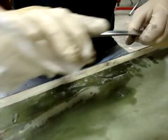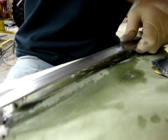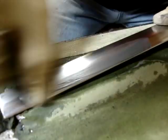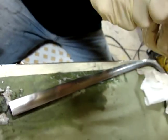So that's the 600 stage. You can always check it and see if you see any deep scratches — you'll want to back up and do a little bit more. I can see just a little bit of the 400 scratches still, so I'm going to hit it again a little bit with 600. Okay, that looks good. I just have one little area in here I want to hit. Now I'm going to go ahead and go to 800.